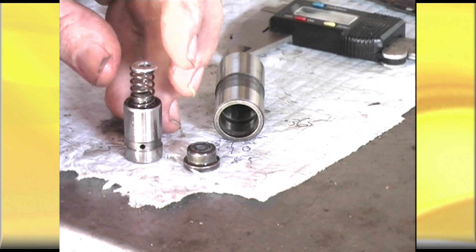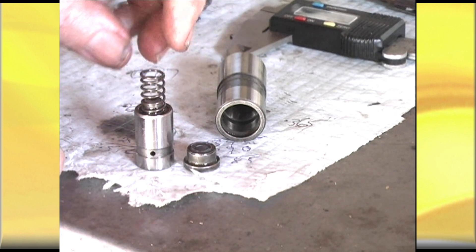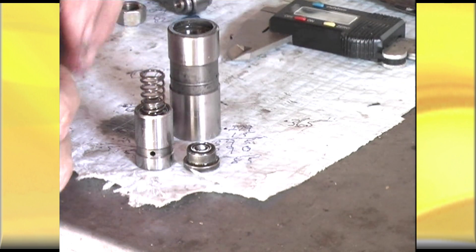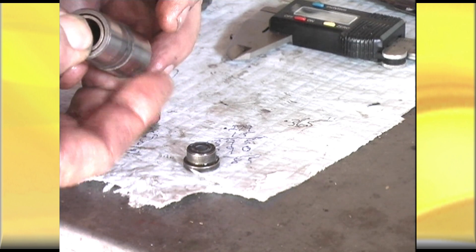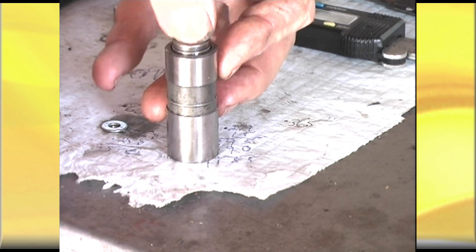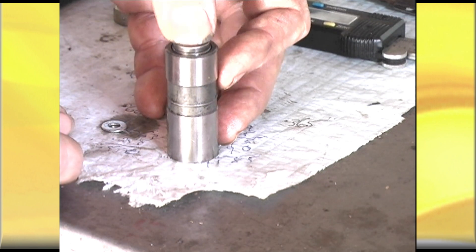All these washers will pack up into the bottom of your hydraulic lifter, and what we're trying to do is get the lifter to lock up much earlier than it normally would. We want about 50 thou left to allow that to compress. Since the plunger goes down around about 4mm, if you start off with about a 3mm pack of washers and pack them down into your lifter body, put your plunger back in. It'll want to come back out because it's trying to compress the air, but if you leave it compressed long enough the air will bleed past the shaft and allow you to assemble the rest of it. Then push it all back in with a screwdriver and put your circlip back in, and test how far that plunger still goes down into the body. Measure it and see if you can get around about the 50 thou mark. If it goes a little more, pack another washer underneath. If it doesn't compress enough, take a washer out until you get it around about that 50 thou.